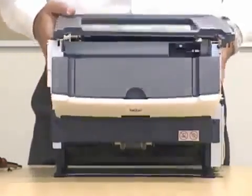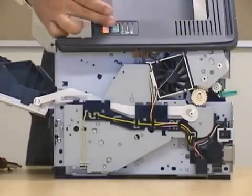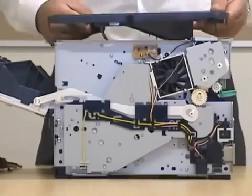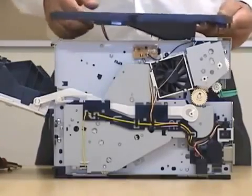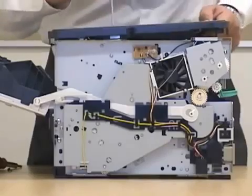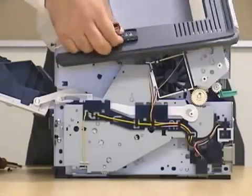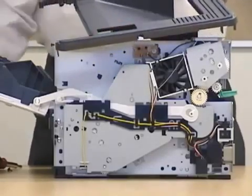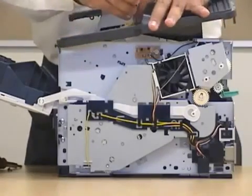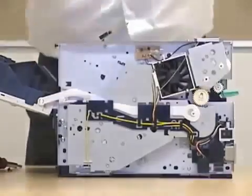This side over here — the control, the power, the stop button — that's really attached. As you can see, there's a wire right here. In order to remove the plate, we use our small flat head screwdriver and you can easily pry it open. You can open the top. Now grab it, put it to the side, slide it back, and now you can remove the back cover.